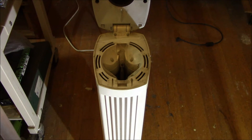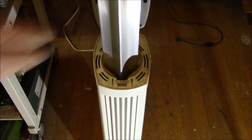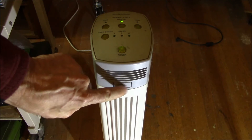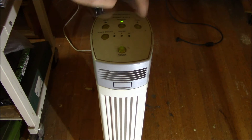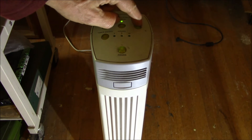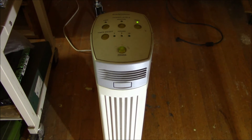Let me show you the problem. I'll drop that in, turn the power on, and you can hear the little fan starts up and blows air out here. On medium right now — there are three power levels: low, medium, and high. You can hear that popping snapping sound and you can definitely smell ozone coming out. If I go to high, it sounds like a Geiger counter going off.